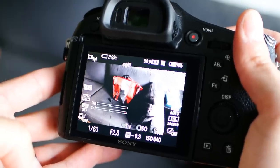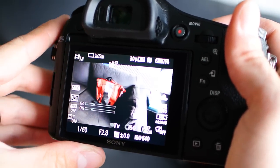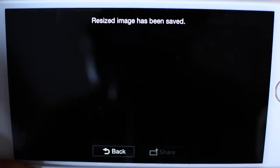First is that you'll find it challenging if you're a one-man band like me. The rear screen only tilts, so you can't look at your framing while in front of the camera. I figured this wouldn't be a big deal since the camera has built-in Wi-Fi — I could just use the PlayMemories mobile smartphone app to check framing and control the camera. No dice, though. Unlike many of Sony's other cameras, the RX10 is incredibly limited in its Wi-Fi functionality. You can get a live view, but the only controls are for the zoom and to take a picture. There is no Wi-Fi control of video mode, and with the still photo option so limited, I'm wondering why Sony even bothered.